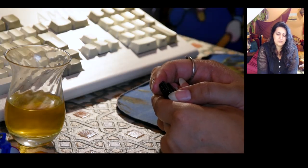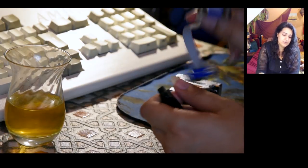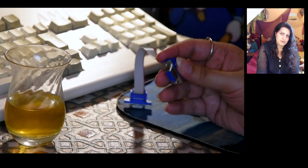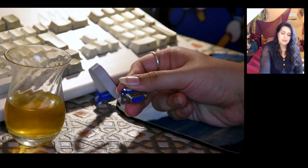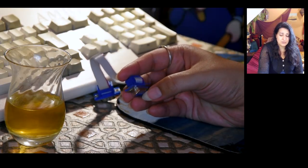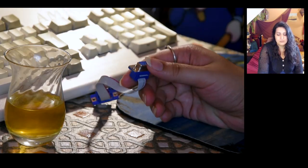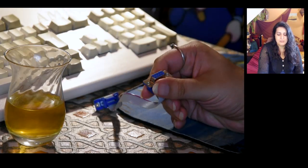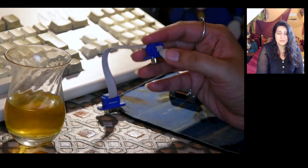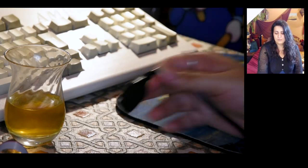But when it comes to peripherals like joysticks or mice that come with metal surrounding, when you're reaching behind the Amiga and trying to plug it in, this metal bit can actually short out the pins, which can screw your CIA chips up. So if you've got any metallic plugs, don't hot plug them, just switch the darn Amiga off and do it. The plastic ones, I think you can just get away with, of course.